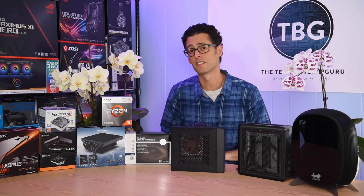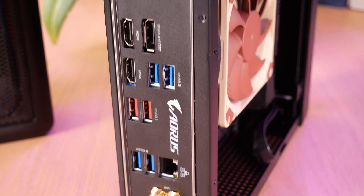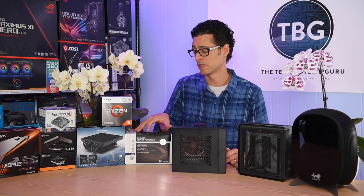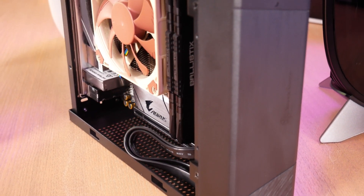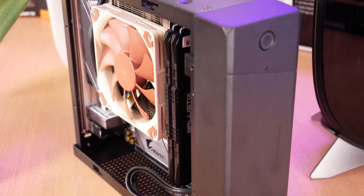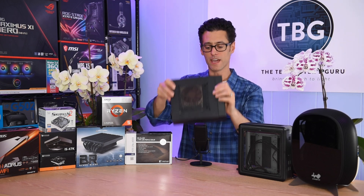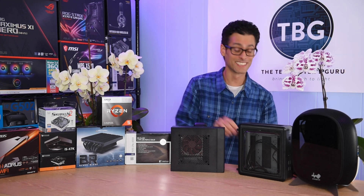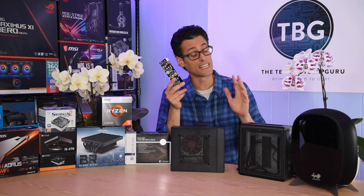I simply was not interested in testing those configurations. In this slim configuration I could use up to 43mm, but there aren't many coolers between 40 and 43mm, so the Noctua 37mm cooler is pretty much the best you can get into this slimline version of the ML10. This is a Mini ITX PC distilled to its essence — basically not much bigger than the motherboard itself. It's extended in the front to fit... well, the DC board, which is notably absent from the standard package.